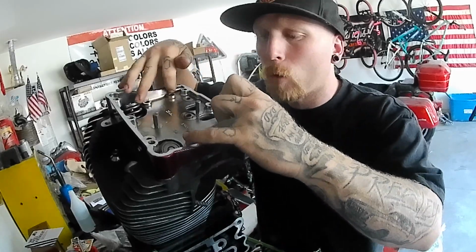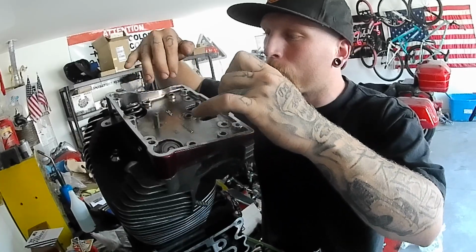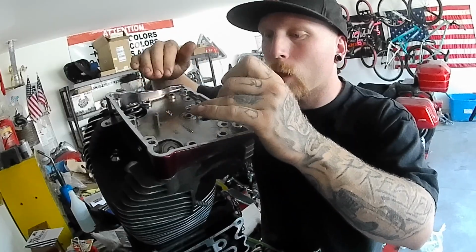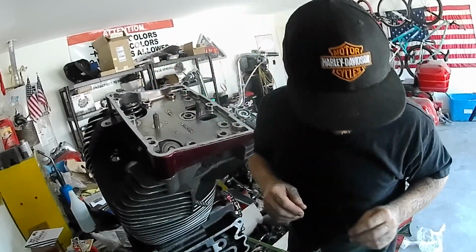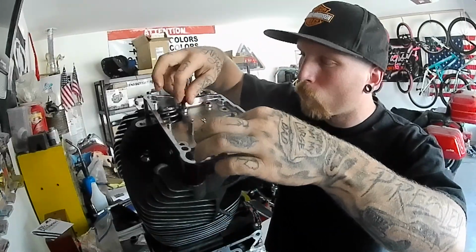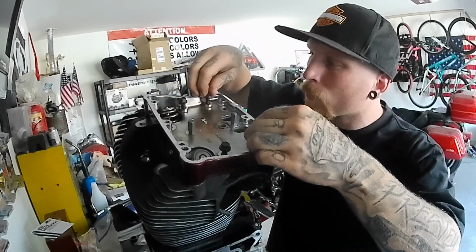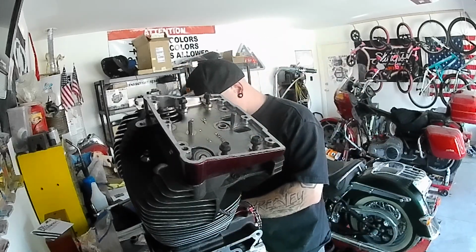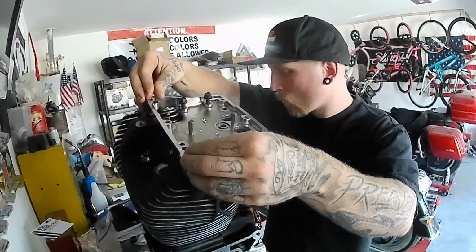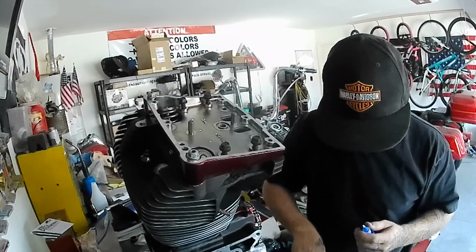So I'm going to go ahead and put my 4 bolts here. Make sure I still get the other one lined up center. I like these for lining them up center. Get my 4 bolts in here, get them in the other side, get some blue Loctite on them, and start torquing the lower rocker boxes down. The torque for these are 10 to 14 foot-pounds, so I'm going to go ahead and split it at 12.